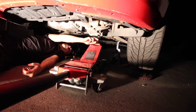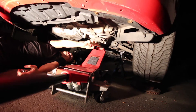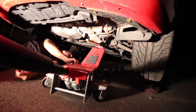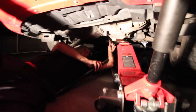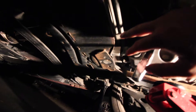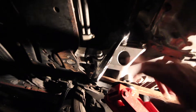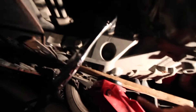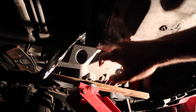Start jacking it up so it can be flat — keep going, keep going, just a little bit more, stop. Got the main motor mount bolt out. Now there's this bracket — it's what connects to the motor mount which connects to the subframe. I ended this bolt, was having troubles with it but it came out. The motor is supported by a block of wood and the jack — you put this on so it doesn't damage the aluminum transmission block.